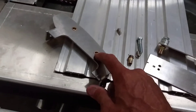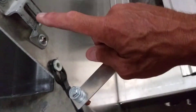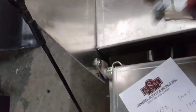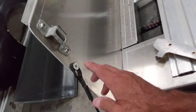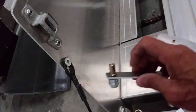To put the pressure on it that's required, the smaller one can use a regular handheld rivet tool. With the bigger rivets, we use these rivnuts on the door strikers, the bolt to mount the cable on the VW Beetle, and down here for the hinge. These are eight millimeter rivnuts. The reason we use these bigger rivnuts on these eight millimeters is because after the body is installed, it's difficult to reach the backside and loosen up the nut. So if you want to adjust your hinge striker or your latch striker, you would have to reach way up in there to reach the nut on the backside.